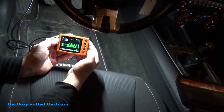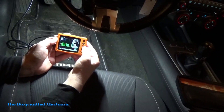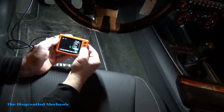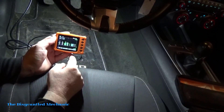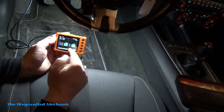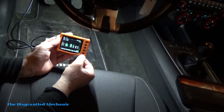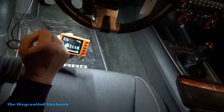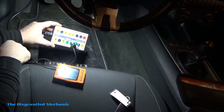If you want your preset reference back on, just hit OK for your menu, scroll down to presets, and turn it on. Now you can see in the background the purple giving you a reference signal. So that's reading both CAN high and CAN low — it can be a quick rundown reading of what's going on.